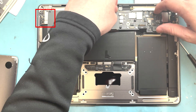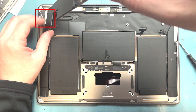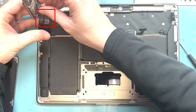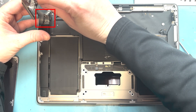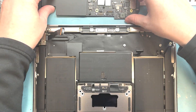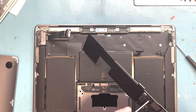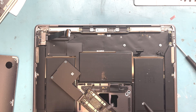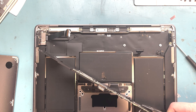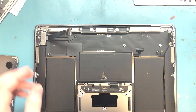It's time to lift the board out, but remember to unscrew these screws and remove the cable — don't do it upside down like I did; there's a much easier way. Just unscrew it so you can disconnect that flex cable that's underneath the board. This was my first time doing the top case replacement so I had to learn the hard way. If the standoffs come off like mine did, get some pliers, hold it, and unscrew the screw while holding the standoffs. Since I'm transferring to another board, I don't have to keep track of the standoffs because I'm not putting it back in this housing.